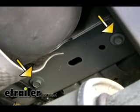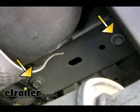With the exhaust lowered down we can go ahead and point out the mounting holes that we're going to be using to install our trailer hitch. Looking at the bottom of the frame you can see we've got two existing bolts here just rearward of the air conditioning lines. We're going to remove those two bolts, put the hitch up, and actually reuse that same hardware to attach the hitch to the frame.